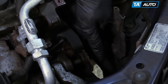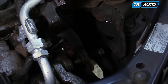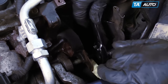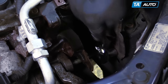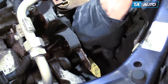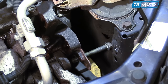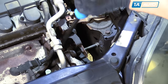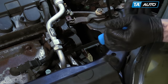In order to get this top alternator bolt out, you have to remove this 12 millimeter bolt and the bracket for the power steering reservoir. Pull this bolt out as far as it goes to let the alternator move out of here.